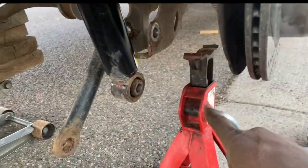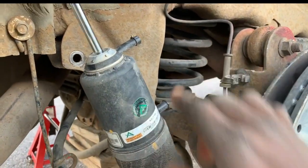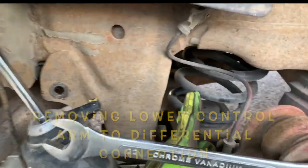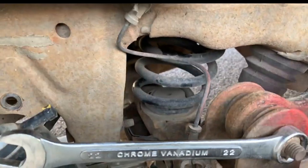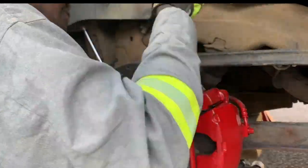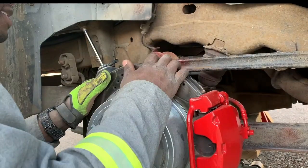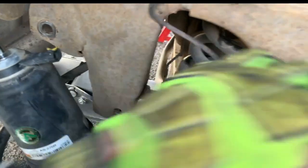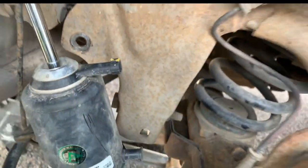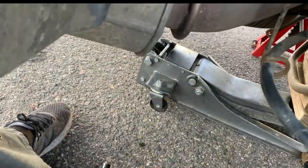Now I lowered the jack and got my normal jack there, so I'll lower the jack stands. I'm going to lower the differential — that should give some pressure for the coils to be able to come down. Once I get these arms released, I'm going to jack it up. The coils should come right out now that they're not being constrained by the control arm. Notice how she's moving now that this is gone — it's just swinging. I'm going to take the other side off and lower it with the jack in the middle, let the jack lower, and we should be good.